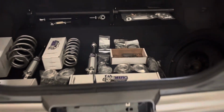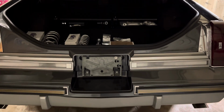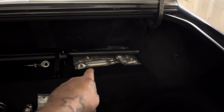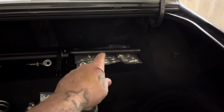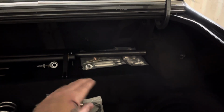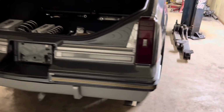So there's no reason a G-body should be going around with under axle mount anti-roll. When the links go up to the frame, they go up to the weakest part of the frame of the car, and it flexes the shit out of that area. Even with the bracket that it comes with being bolted on that area of the frame, that frame is just a weak ass area, it will crack. So anyways, just saying.